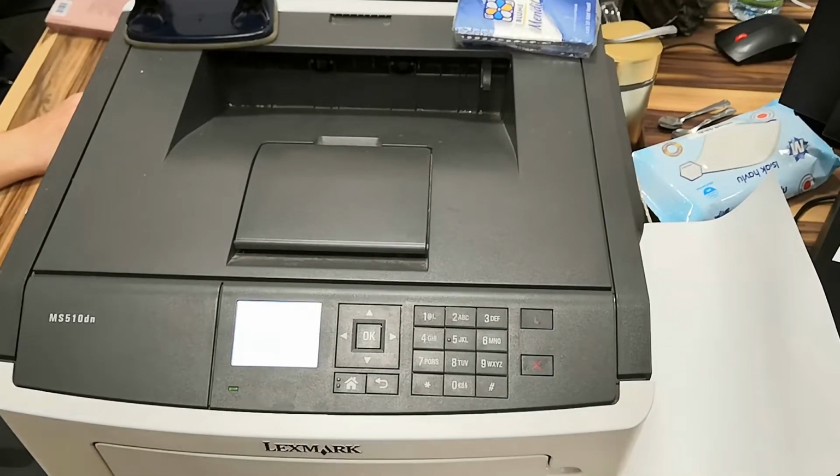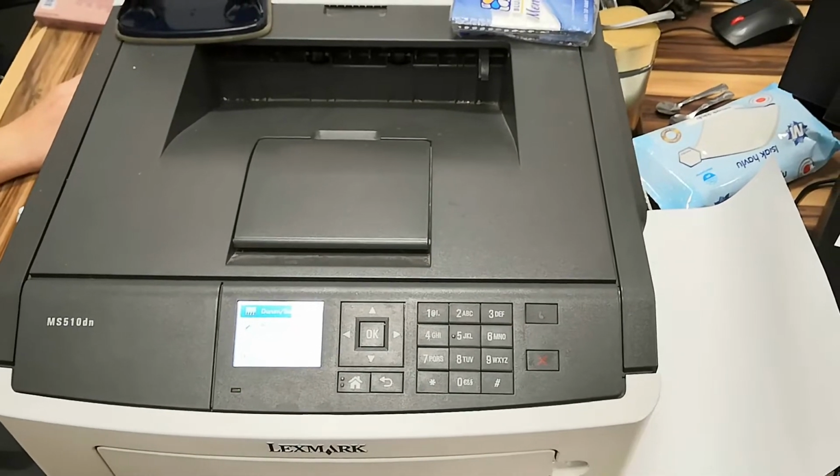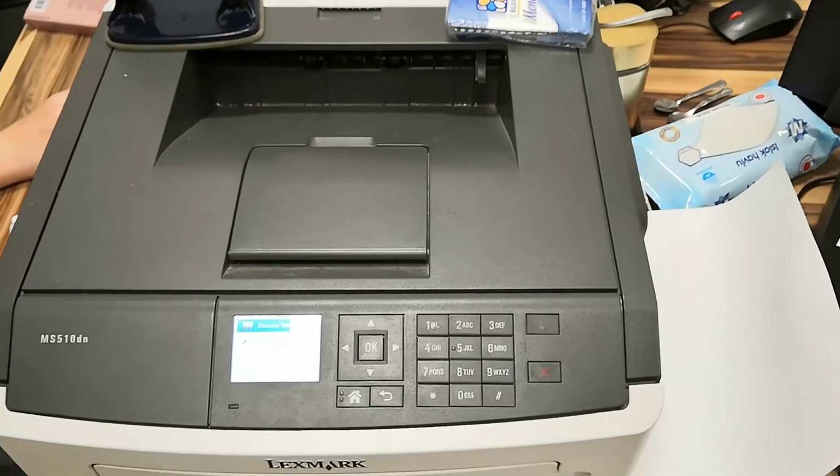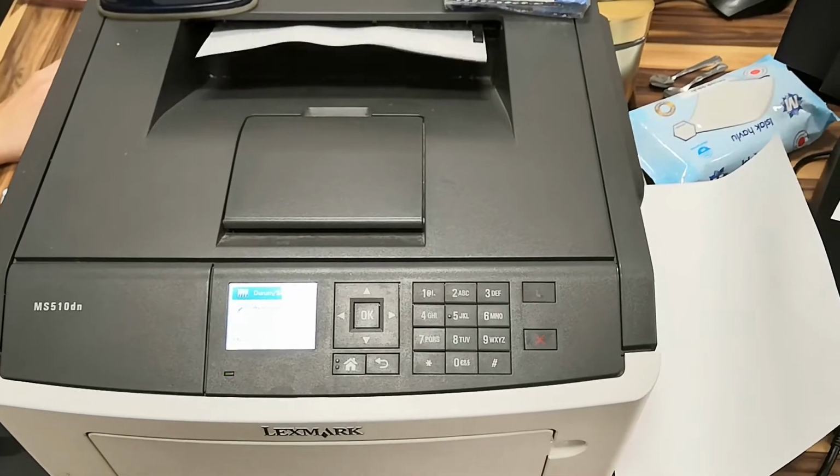Our printer has a problem with a dirty, stained or streaky printout, and this issue is 90% likely due to the drum unit. We replace our drum unit and get a clean printout. We can try to produce a more economical solution instead of replacing.